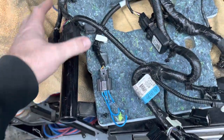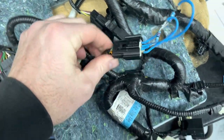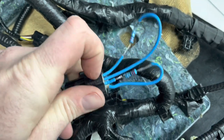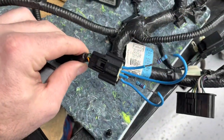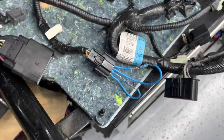Now we're going to try to get this airbag light off in the car using the harness taken out of the original OEM seats, to put into our aftermarket seats — really just to get the airbag light off so you don't have any weird warning lights. Here's the passenger side harness with the bladder. For the airbag plug, I've taken a 2.2 ohm, one watt resistor, soldered it in line using a couple of wires, and shoved it into the actual plug itself so I didn't have to cut the OEM harness plug. It's in there pretty securely, and I'll tape it all up once I verify everything works.